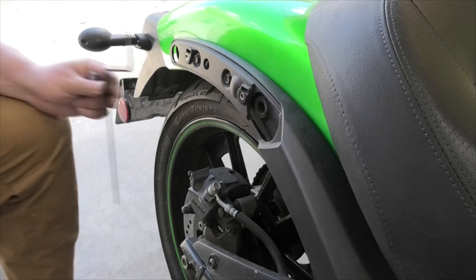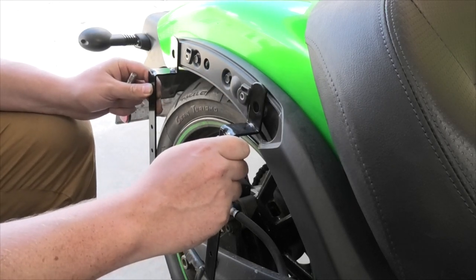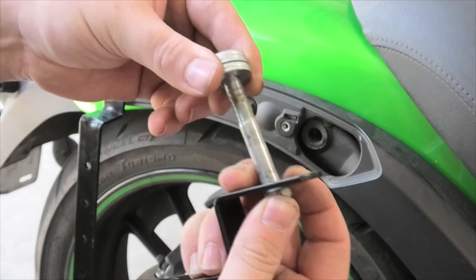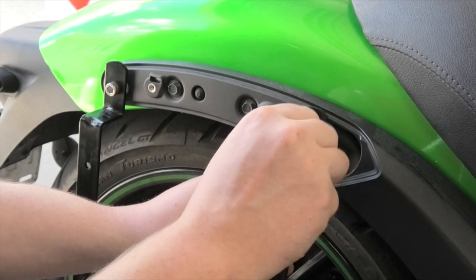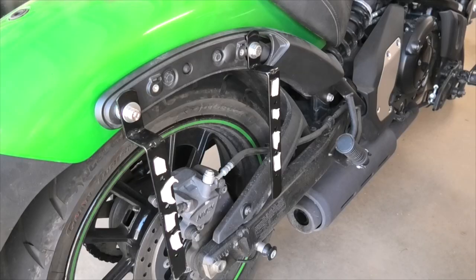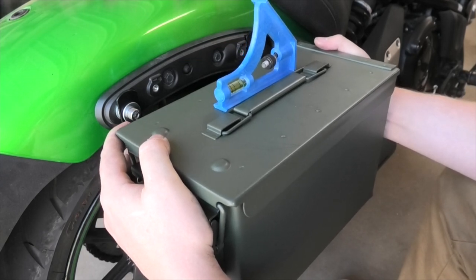I started out by mocking up the mounting brackets on my bike. On this machine, the brackets need to be spaced away from the frame, which is where the washers come in. To complicate things, the two brackets need to be spaced out by different amounts. After a bit of trial and error, I found the correct amount of washers to put behind each bracket to ensure they lined up correctly. I made sure the brackets sat parallel to one another and tightened them down. I then put some foam mounting tape on the brackets — this is temporary, just to hold the can in place while I line it up. Making sure to keep the can level, I eyeballed a good mounting position and stuck it to the brackets.